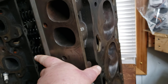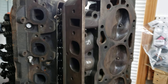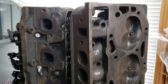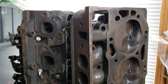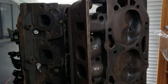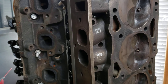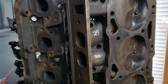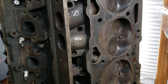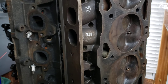The main reason I'm even thinking about doing head swaps on my 454 in the truck — I can't get the headers to fit. The only way I can get the headers to fit is to jack the motor up, but I don't have the means to lift it high enough. So either the engine has to come out or the heads have to come off. And if the heads are coming off, I might as well replace them with some better heads. Not the Pro Max heads — not on a 7 to 1 or 8 to 1 compression motor. I'm not wasting those.